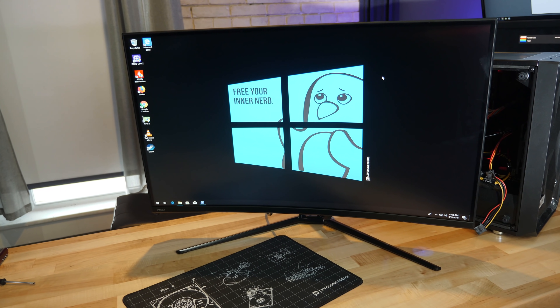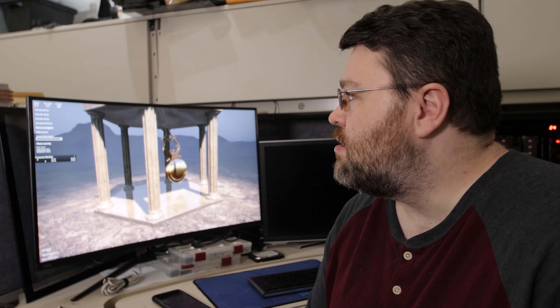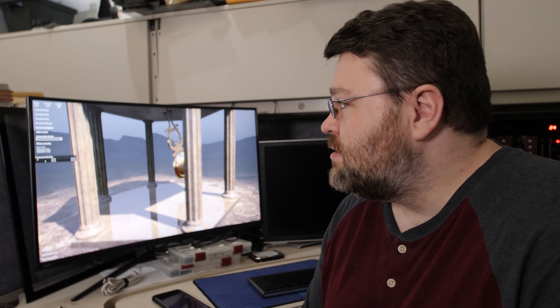This is the Pixio PXC32. It's got a great FreeSync range — G-Sync compatible range from 20 to 144 hertz. Like most of the other monitors, I really recommend 30 to 144 hertz. I get a little bit of flickering between 20 and 30 — it's not the worst I've seen, but not the best either. But it looks great, it looks amazing. Good job, Pixio.